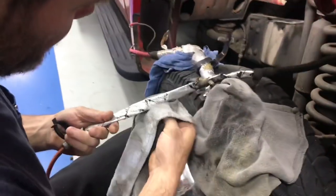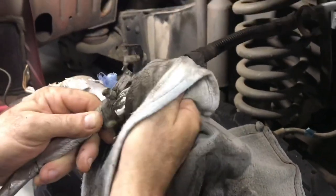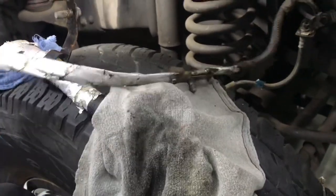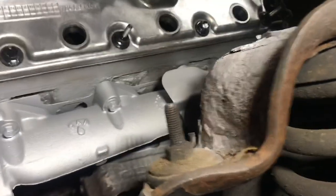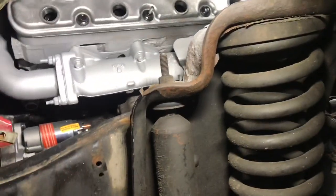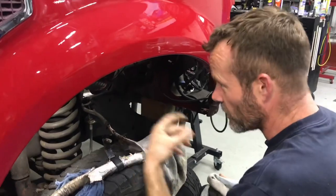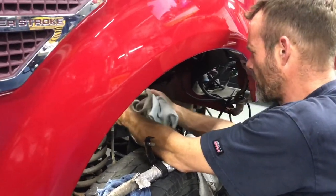Background note — it's grandson day today; he's outside counting rocks in the driveway. We're going to clean this and wipe it off because we didn't take it off the truck. It's run down, all snow-plowed up, and was completely covered with nasty nastiness — now it's touchable. We'll put this back on the battery cable. We got the manifolds torqued, the valve covers back on, the heat shield on, the starter in. Now we're going to get the battery cable set, then put the AC compressor in, then the negative battery cable, and then we'll be pretty close on this side — glow plugs, accumulator, and the line.